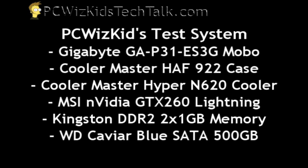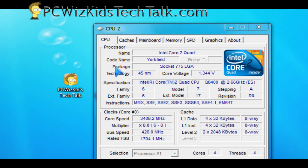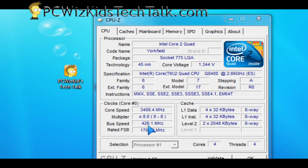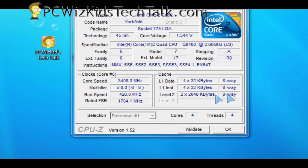Here is the CPU-Z information for this chip. It's detecting at 100%. You can see the voltage — roughly 1.344 volts — and all the specs for that chip. The one thing you want to notice is that 3.4 GHz. How did I get that? I put the multiplier in the BIOS to 8, and then I increased the bus speed from about 420 to 430, trying it in small increments. Basically it gave me a hassle-free 3.4 GHz.